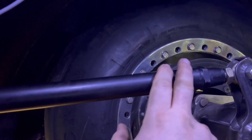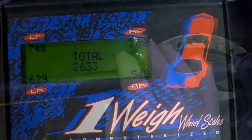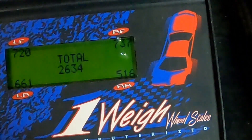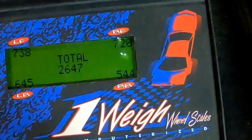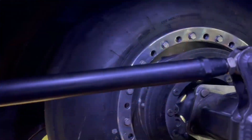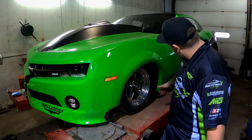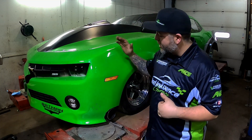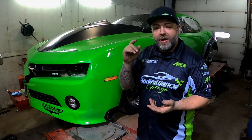All we're doing is turning the bar one flat or possibly two flats. If you turn it one direction it takes weight off the tire; the other direction puts weight on. You never want to go more than two flats — if you need more than that, it means you need to redistribute weight elsewhere in the car. We're done with the scales, everything's cleaned up, and the car is back down.